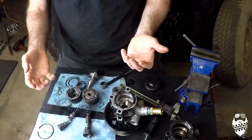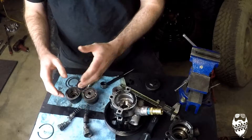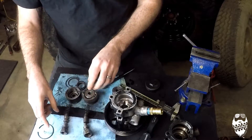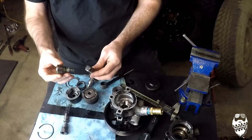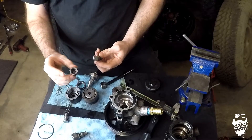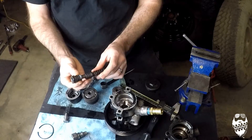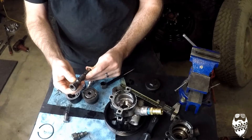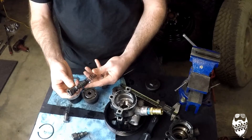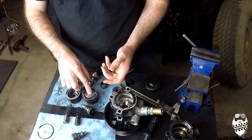I'm not a professional — that's just my opinion on why the WJ and TJ are different. I believe if you swap out the control valve on your TJ pump with a WJ control valve setup, you'll need to change the fittings because they are different sizes. If you drill out the TJ valve bore and run the WJ flow control valve on your TJ pump, you will probably get some sort of an upgrade. I experimented with this and wasn't super happy with it, so I ended up just buying the PSC power steering pump for the TJ, and so far I've been really happy with it.